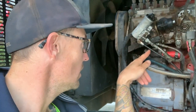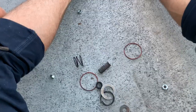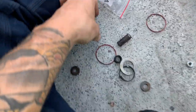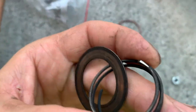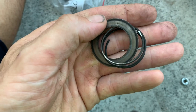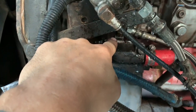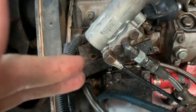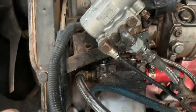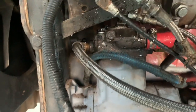We found three faults, I'll run you through them. First one was one of the springs seemed to be a little bit shorter — we felt it may have worn off or accidentally broke when I was working on it, and it didn't have enough push to push the valves open. The other possibility was that when I was remounting, I could have had it turned a little bit and it wasn't fully able to push down on the valve. Dean said there was a bit of a lip on the pushes — maybe it was pushing but not releasing, I don't know.